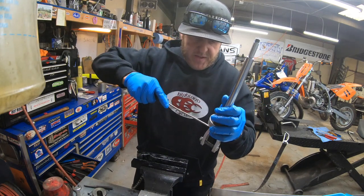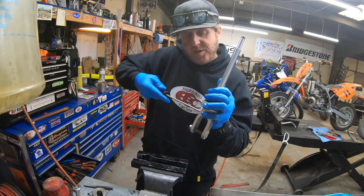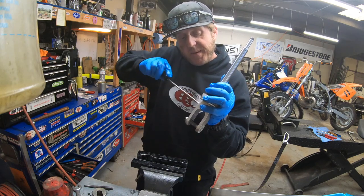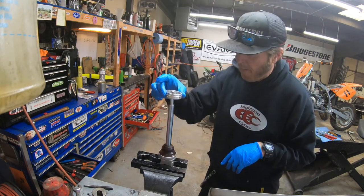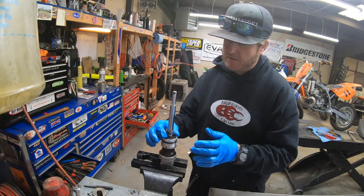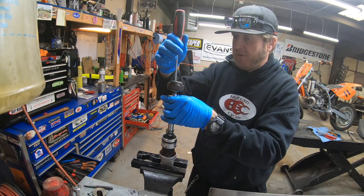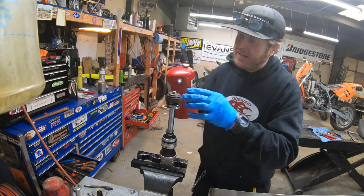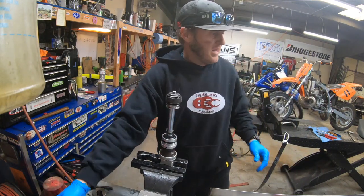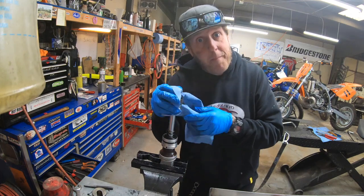I didn't count the clicker clicks before I took it apart — doesn't matter much on this one. It was like 22, which is basically all of them. I'll have to ask him — this is a friend of mine who actually used to be a mechanic for me years ago. Reassembling the valving — since we have it on the screwdriver, we just lower it back into place. I like to brake-clean this even though it has a locking nut on it. Still like to put a little bit of Loctite on it — belt and suspenders, people, belt and suspenders. A little bit of red Loctite, put that on there.